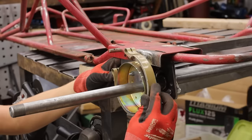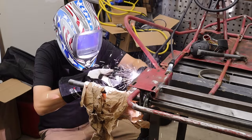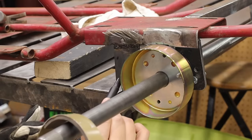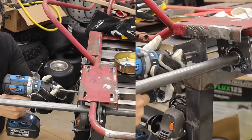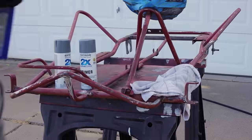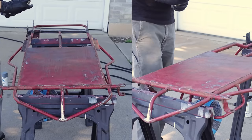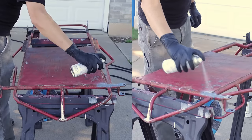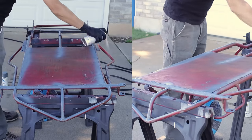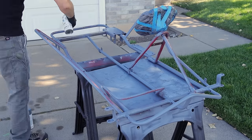Going with a live axle lowered my axle by a couple inches, so I needed a new mounting for my brake band. I had some scrap 1/8 by 2 inch flat bar left over from my welding table — it's worth buying extra for those odd-and-end projects you don't think of until later. It was as simple as welding it on and drilling a hole for the bolt. After all that welding and cleanup, I do a quick wipe-down with acetone to get rid of residual dust, dirt, and flux spatter. For primer, I'm using a basic rattle can of Rust-Oleum primer since I'm switching colors and want better consistency.